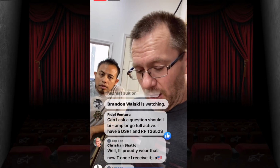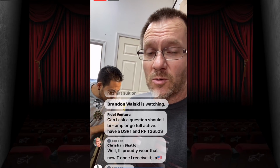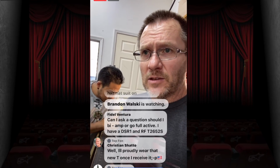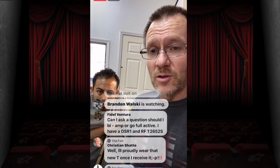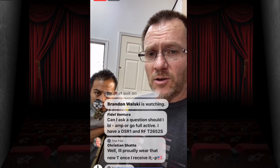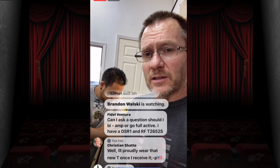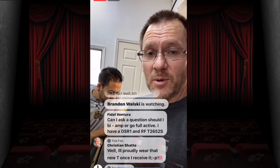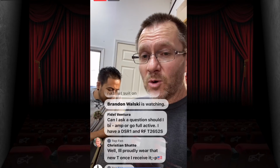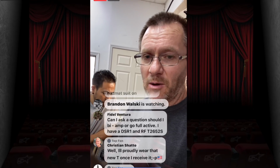But what going full active will give you the ability to do is actually have some level control, which is really nice. So you get basic level control with a passive crossover network. You know, usually it's 0, -2 on the tweeter or -3 on the tweeter. When you go full active, you will get full control of that tweeter, and you may want to turn it down a little bit more. So it just adds a little bit more adjustment to it. That's really where the fun is. It's not the power. The power is so minimal.